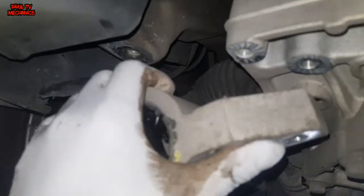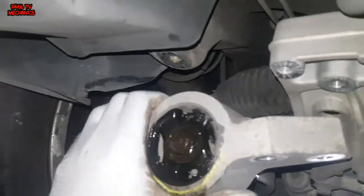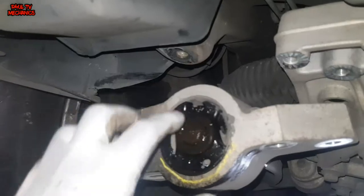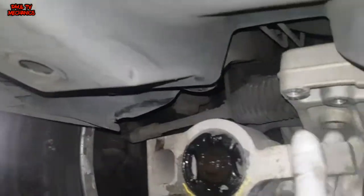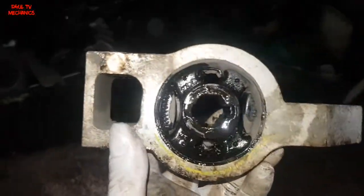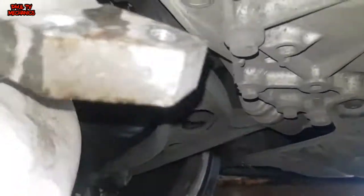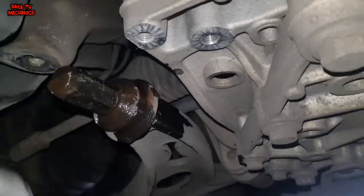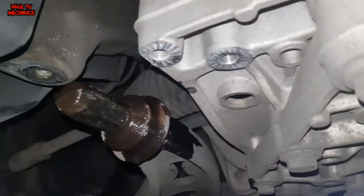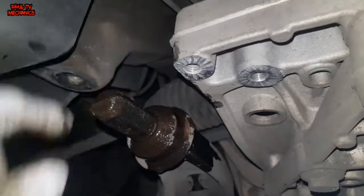Alright, so there we have it — it's barred down all the way. As you can see there, we've got a gap. All you do now is twist it. I can't do this with one hand so I'll just explain it — you twist it all the way, full lock basically, full turn. Twist it all the way and that will just fly straight out. All you do is turn it full turn either direction. You'll see it when you get to it — you can't turn it one way because it hits, so you turn the other direction, full turn. Plenty of oil, and once it goes full turn you can just pull it straight out.